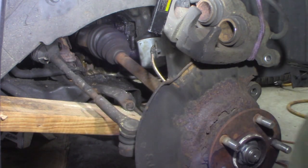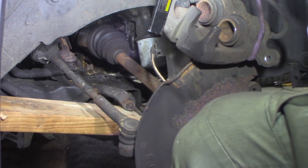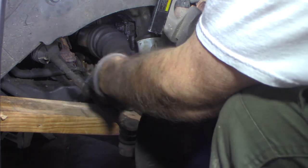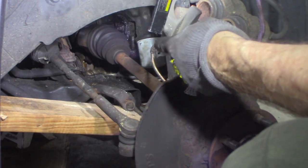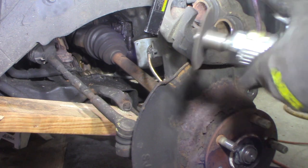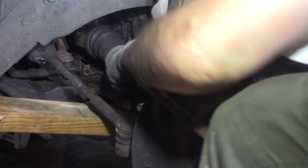That's what it looks like now. I've got to go back and just clean that up — kind of shave that off. I don't think I can just punch that through, there's still too much metal there. I think I'm just going to take a cutoff wheel and go in there and grind that down a little bit, make it flush, so the only thing through there is what's going through the hole. I am wearing ear protection and eye protection for this — I do like my eyes and I'm already deaf but I don't need to be deafer.